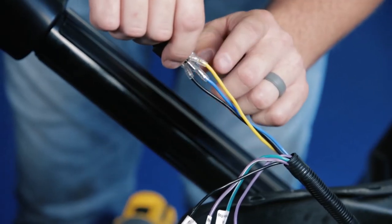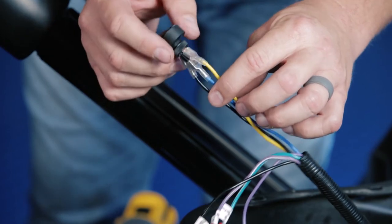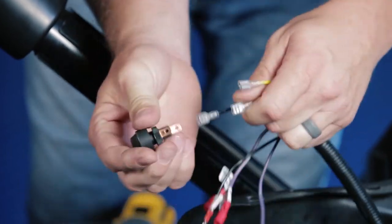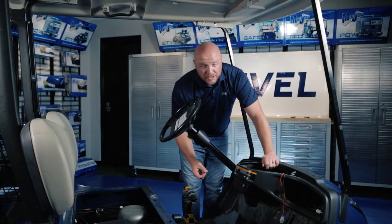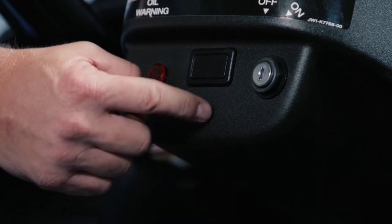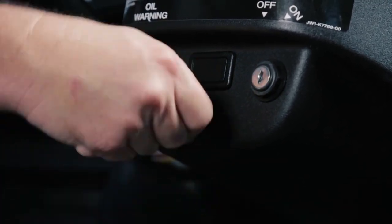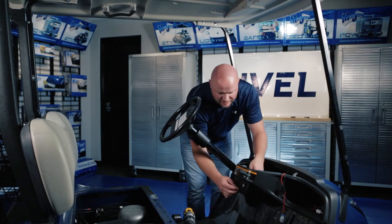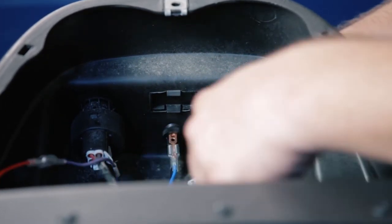Next we're going to take the black, blue and yellow wire off of the back of our hazard switch. Note that the black wire is behind the LED light on the switch, the blue is in the center and the yellow is on the top — this needs to go right back in the same way. We're going to disconnect it temporarily from our switch. Then we're going to take the nut off the backside of our switch. Then we're going to use a 15/32nds drill bit and drill a hole to mount our hazard switch. On this particular cart, we're going to put it right here below where the battery meter would go. Your cart may be different — just make sure that where you're going to drill, there's no wires behind that can get cut with a drill bit. Remember to wear your safety glasses. Once your switch is in, go ahead and secure it with the nut. Now you can reattach your black, blue and yellow. Remember — black on the bottom, blue on the center, yellow on the top.